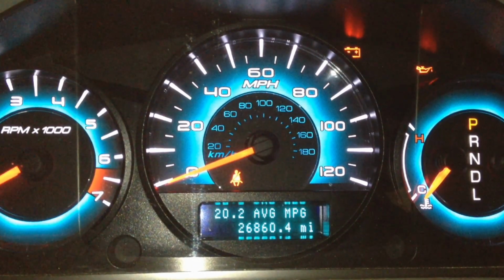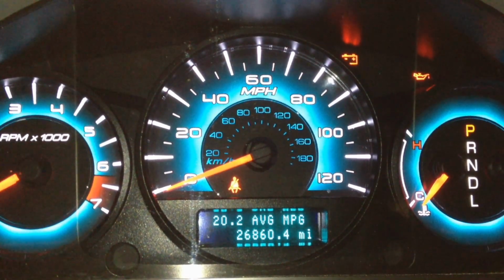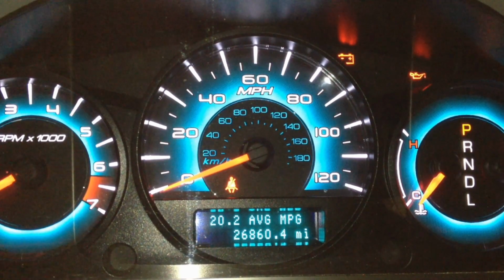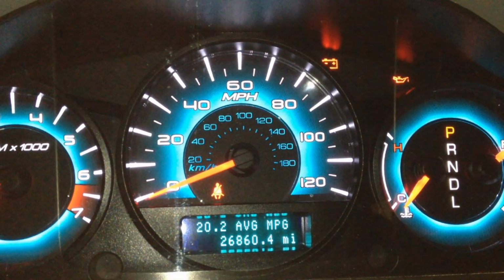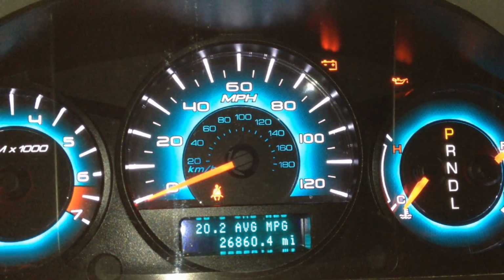And then make sure you clear your check engine light. Either you can take it to AutoZone, or you can do it yourself. I have a whole video on that. There's a procedure to do it properly down in the description. So you can clear your codes, and then just drive it a couple of days, and you'll be able to tell if it's still seeing a leak or not without actually having a scan tool to run the test.